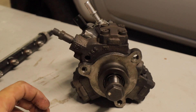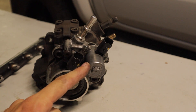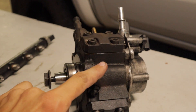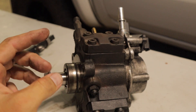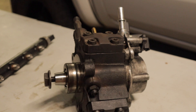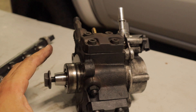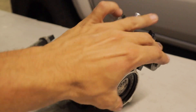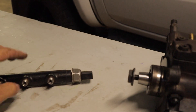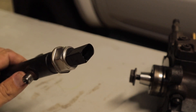Just a quick recap: if we had a faulty regulator, we'd see a big difference between the desired fuel pressure and what the actual pump is putting out. If there was a broken plunger spring, same scenario — you might see a desired pressure of 50,000 kilopascals but the actual would only be 10,000 to 15,000. That's a good way of diagnosing either the fuel pressure regulator or a broken plunger spring. With the pressure sensor, if it was faulty, you'd see a zero voltage reading — pretty easy to diagnose.